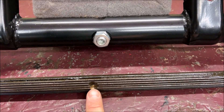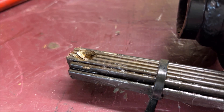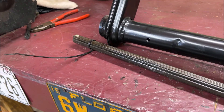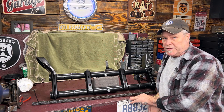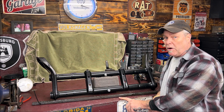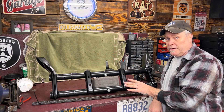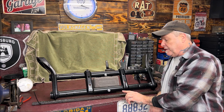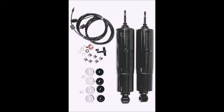You can see there is what you tighten and they go inside of here — that holds the torsion leaves in place. Over here you have indentions in the ends, and that is where your control arms go on. These torsion leaves come out of here. To do the through rod system, these torsion rods — leaves, bars, whatever you want to call them — must be removed. You would install the through rods through the beam, then put your control arms back on. But when you do that, you've lost all your tension, so then you put on air shocks.